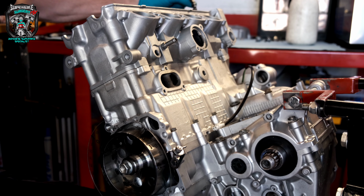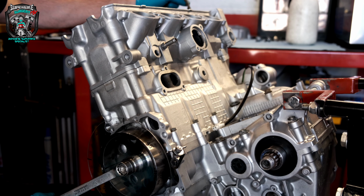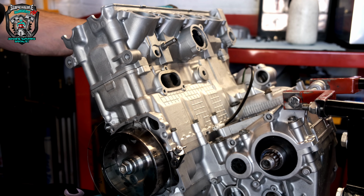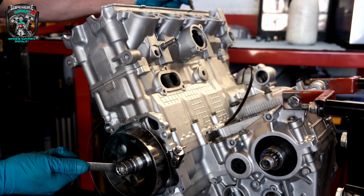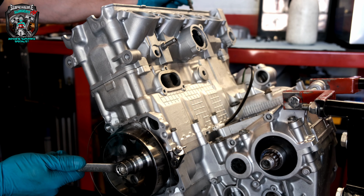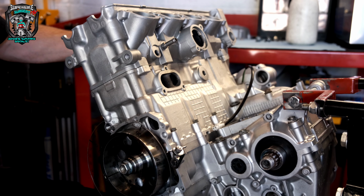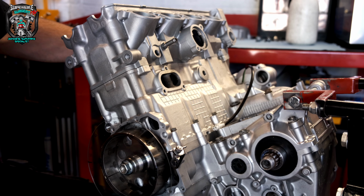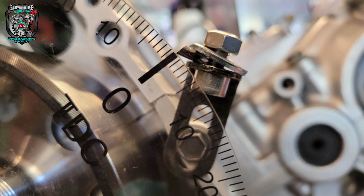Okay, I'm going to hold the cam chain so I don't get it trapped around the crank. And I'm just going to turn the engine, and this, by the way, will turn independently of the crankshaft. It's on a little rubber noggin on the centre here. Anyway, I'm going to turn it till the piston hits the TDC stop. And I'm going to adjust this. I'll take a still photograph of this so you can see what I'm doing, and I'm going to line up the little pointer with the TDC mark on here. Right, so hopefully you'll see from that photograph that's on TDC now.